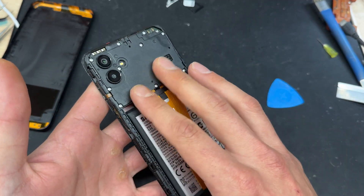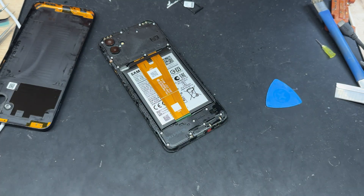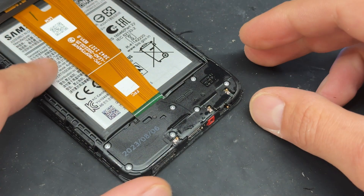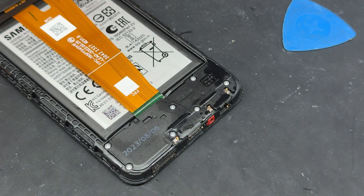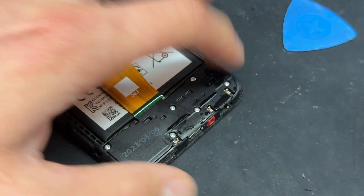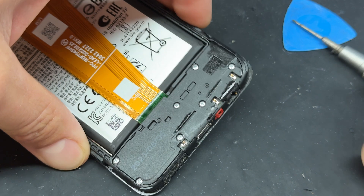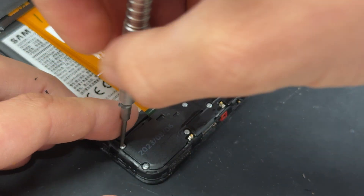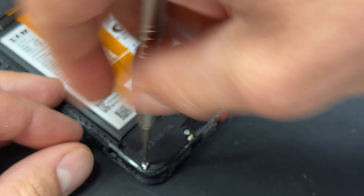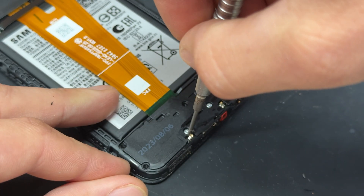Because this device has got no charging, we're going to be perfectly safe just working around this bottom area without having to open up the top and disconnect the battery. So we've got seven crosshead screws, and it looks like there's a bit of water damage or some liquid down there — whatever it is it's gross — but let's move on and remove these seven screws holding down the loudspeaker and plastic cover at the bottom of the phone.